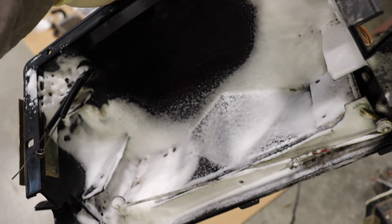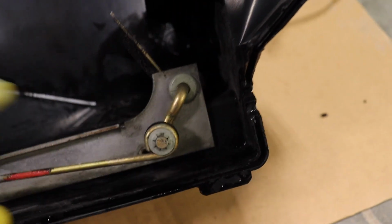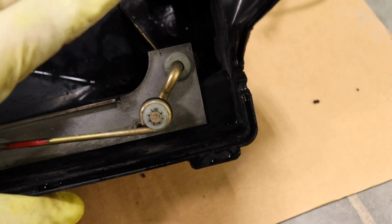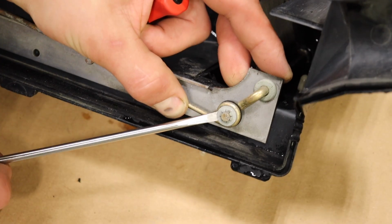Nice. Also, it's a good idea to clean the boxes thoroughly as well. So we're going to be replacing these bushings. They're actually in pretty good shape, but we have new ones and it's apart. The other 2002 boxes that I've rebuilt, these have been totally toast. But you have to pull these clips off. You have to be a little careful, but...